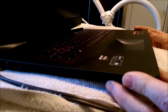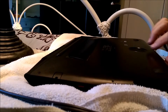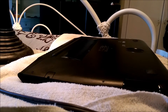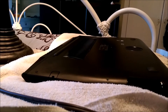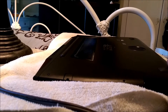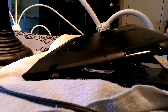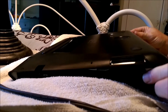Sorry for the very bad production of my video here, but I'm on a limited budget. Anyway, once you've got it popped open a little, you can flip it over and use a pry tool — I actually have a tool for opening up cell phones. You can get in here and start going around and pry up the rest of it, and once you've got about that much the whole thing pops up, then you slide it towards the back and it pops off.